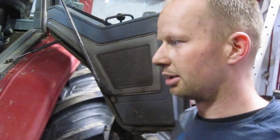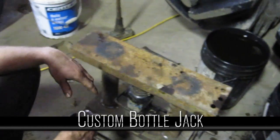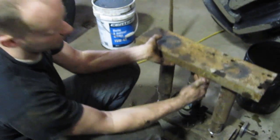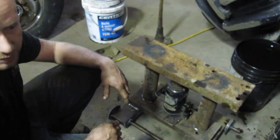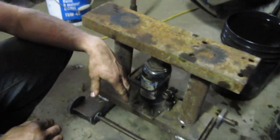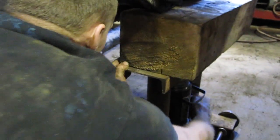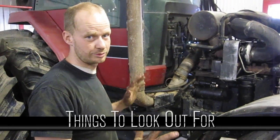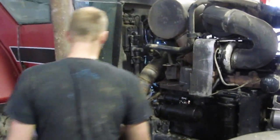It's a big tractor and I didn't want to use just a floor jack, so I welded this up — just a bottle jack with two pipes to keep everything steady with no chance of the tractor falling off the jack. Put a wooden block on there — steel on steel is never a good idea. Maybe just put a couple of screws in there to hold it down. We're just about ready to roll the 7140 apart.